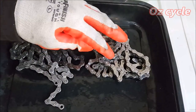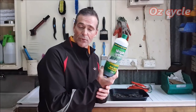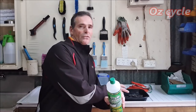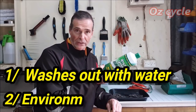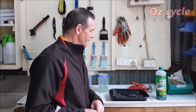If it's not as clean on the outside, it definitely won't be as clean on the inside either. Looking at both options: Simple Green has two advantages. First, it doesn't need a degreaser afterwards - it is a degreaser in itself, so you can just wash it out with water. Second, it's more environmentally friendly, whereas petrol is not.